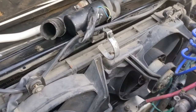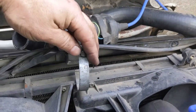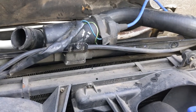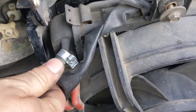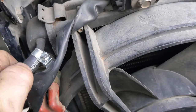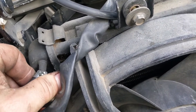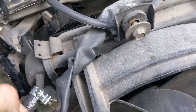Radiator time. First step is to remove the coil — it's in a bracket right here, single 10mm bolt. Undo that, withdraw the coil, and set it aside. You'll need to loosen the hose clamp on the overflow hose. Be really careful here — this is plastic and it gets brittle over time; if you force it you can break this nipple off pretty easily. So be gentle.